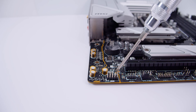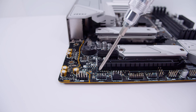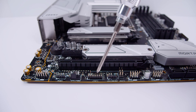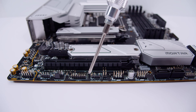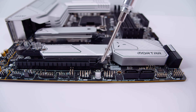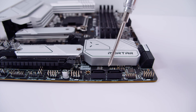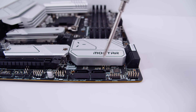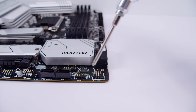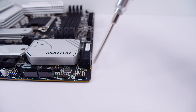First off we've got the front panel audio header. There's a 4-pin 12-volt RGB header. There's a PWM fan connector. There's a Thunderbolt header which requires an add-in card. There's a 3-pin 5-volt addressable RGB header. There are two USB 2.0 headers for stuff like AIOs and RGB controls and whatnot. Two SATA ports for your 2.5-inch SSDs or spinning hard drives. A TPM header, which you don't need to use because TPM is built into the CPU. And the front panel header for all your lights and switches.